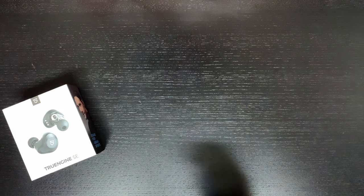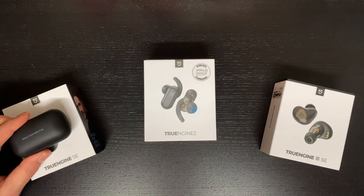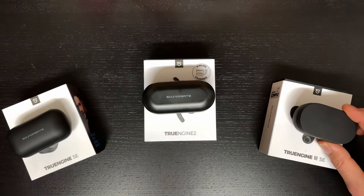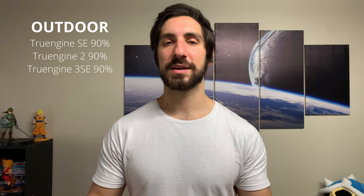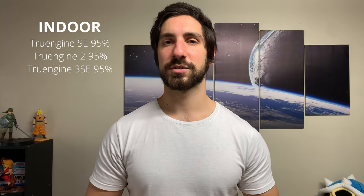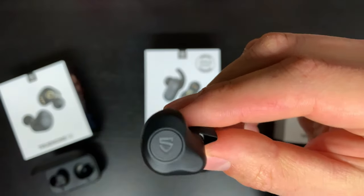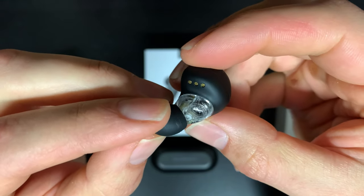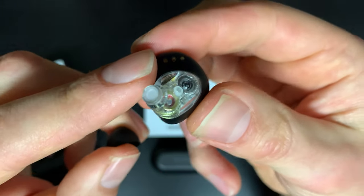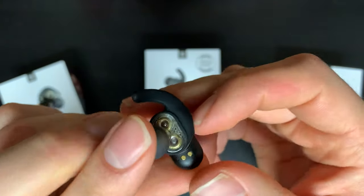On to Bluetooth and connectivity — pretty much the same across the board. All pairs have the Qualcomm 3020 chip, giving you SBC, AAC, and AptX codecs — the best codecs out there. In my Bluetooth range testing, they all got 90% on my outdoor test across 27 meters in a clear open space and 95% on my indoor test — 17 meters downstairs through about five walls. Latency is basically the same on all: barely any on YouTube and Netflix. For gaming they won't be as good as dedicated low-latency earbuds but should do the job. Overall connection is relatively stable with very few random disconnects.